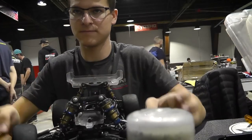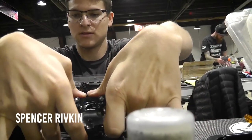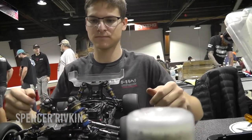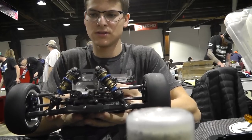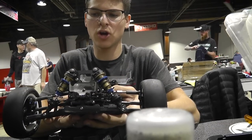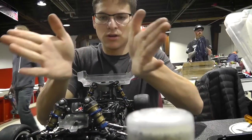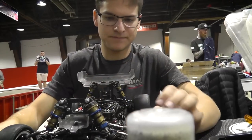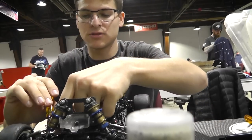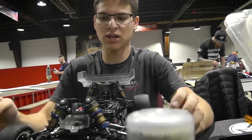We're gonna check out that Ackerman. Now we're just checking the toe. Okay. Show us the toe. What's the deal with the toe? Well, I like a little bit more toe in the four-wheel drive. Kind of helps numb out the car. A little bit spread out. We'll do a little bit more. So you want bump out? No. You want it to be resting toe out? Resting toe out. Just a little bit. Okay.